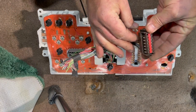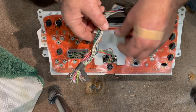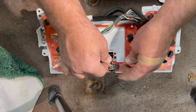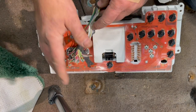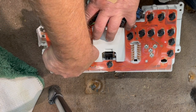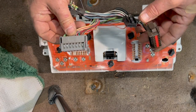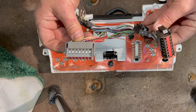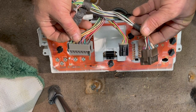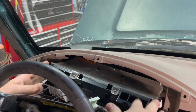This one came out fairly easy, but again when you're working behind the dash it's not that easy — you can't see it. The center clip is the same: squeeze a tab like a normal clip and pull it out. The last plug is the horizontal plug — grab the two sides, squeeze, and pull it out. This came out fairly simple; it probably won't be this easy behind the dash since this one's obviously been taken apart before.